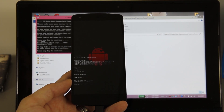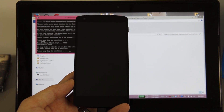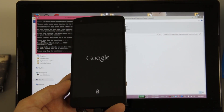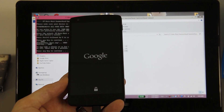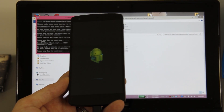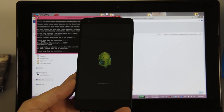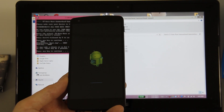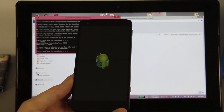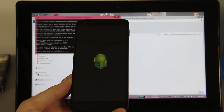This is the easiest method by far. All you need to worry about is drivers. If your computer isn't recognizing your phone, try a different USB port or a different cable. I spent two hours with somebody on Skype wondering why custom recovery wasn't flashing through fastboot — they tried a cable from their brother's phone and it worked fine. Try different USB ports, different cables, uninstall and reinstall drivers, or try a different computer.